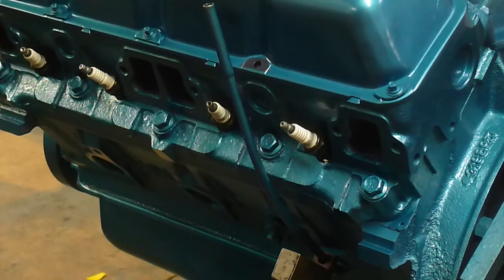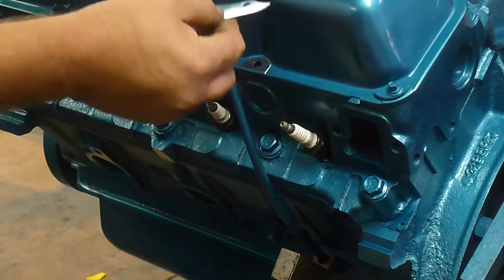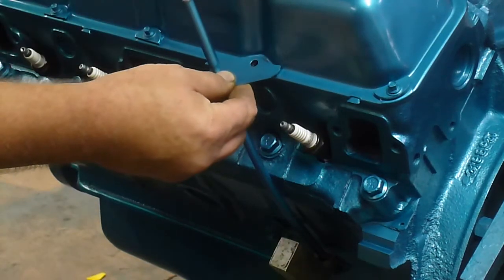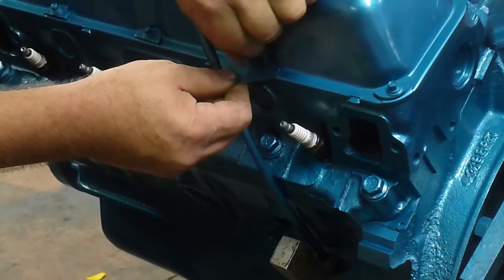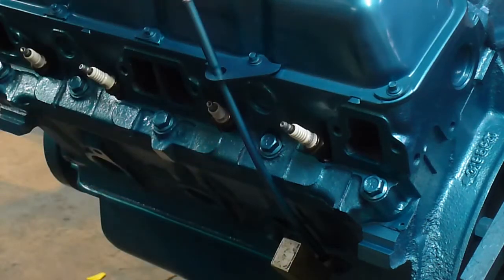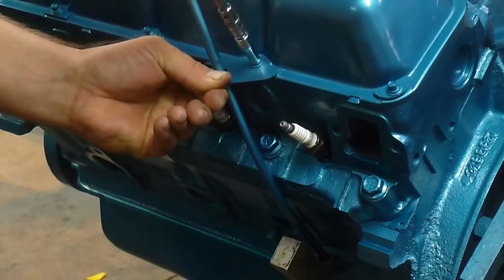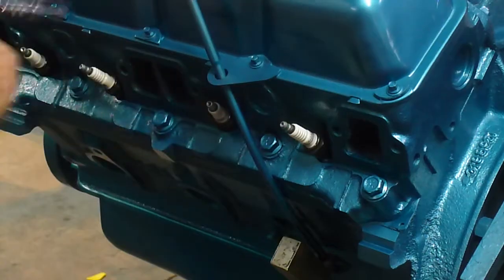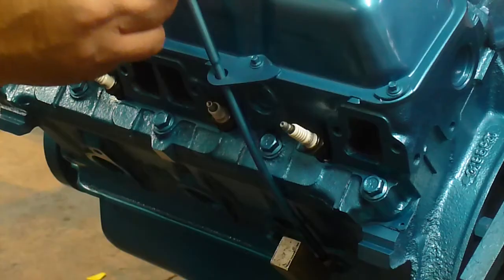In order to keep that position properly, American Motors made this tab that was installed on engines after 1971, but you can also buy a reproduction. Install this tab over the top of the tube and then use one of the regular valve cover bolts — a quarter-inch headed bolt — to hold it in place. Tighten this down snug so it's square.